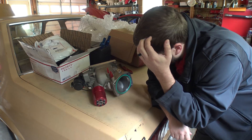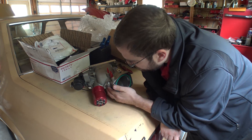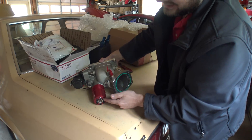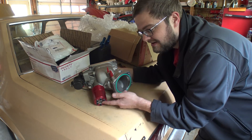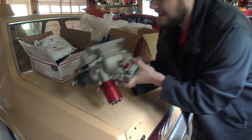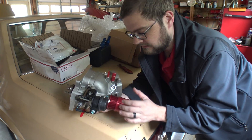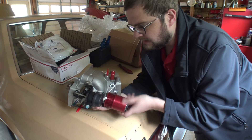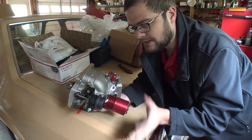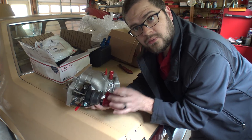I already have the gasket on the blower. The blower snout comes out to here and there's a separate 10-rib blower drive on these engines - there's AC which is like four-rib, six-rib accessory, and then a 10-rib front blower drive only. I don't have room for that on my car. What they do for C5s is cut the snout, machine it all back, modify the snout to fit the smaller pulley. The end of the drive shaft comes out to here and this pulley is back-cut that far to get to stock Corvette accessory. A lot of people with a keen eye notice this is eight-rib - he puts an eight-rib on it in case you ever upgrade the car to eight-rib, so it just doesn't ride on two ribs when running six-rib.